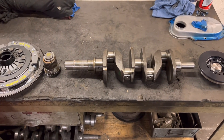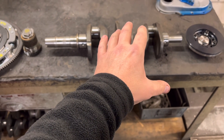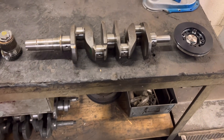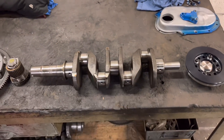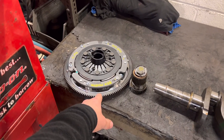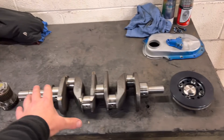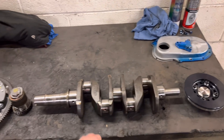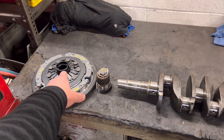When I said I can't really go any further with the Mini, I was actually lying. We've got the crank here — I've checked that, it's due to be polished. I always balance the crank first before it's polished, because on the crank balancer it runs on the end two mains and it stains them a bit on the rollers, so we normally leave the polish until after. We've got the crank assembly with the flywheel and clutch cover, the gear that goes on the front end, and the new front pulley. The order we balance: set it up on the rollers, balance the front end first, then the rear end — that's the crank balanced. Then the front pulley, then the flywheel, and the clutch last.